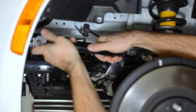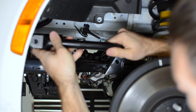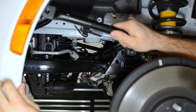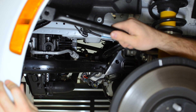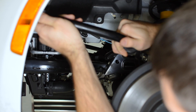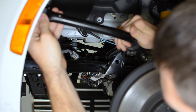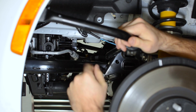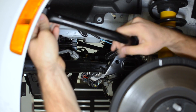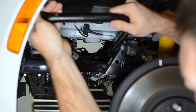It can be a tight fit so don't get frustrated. You're going to work the bar towards you and wiggle it around. Make sure you don't hit the coolant sensor and break it off — that's over on the right-hand side. Keep pulling it towards you, watching the end of the bar on both sides. Make sure you're not stabbing it into the radiator fan or anything else. I like to put my hand over the end of the bar to try to protect the bumper.